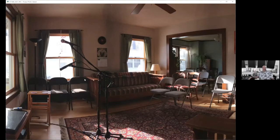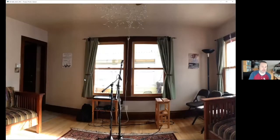And the room mics were unbalanced RCA connectors, right? So you don't want to run them all the way over. Yeah, and actually, you mentioned that from one of those early shows when I was setting up, I was listening, and I'm like, oh, I'm getting a lot of hum, and I'm trying this and that. I finally figured out that I was using a 20-foot RCA to RCA stereo cable, and the cable I was using was a newer one, and I had an old cable that I'd had for 15, 20 years at that point, and it was twisted, it was mangled. I tried that one, it was fine. I don't know if it was something with the twists in the cable or what, but it was one of those things that, well, I guess this works, so I'll use that.